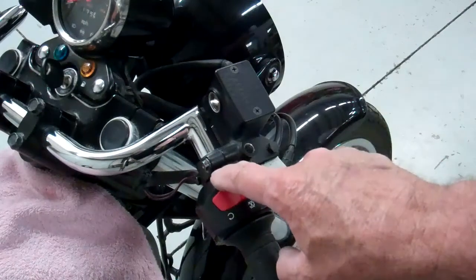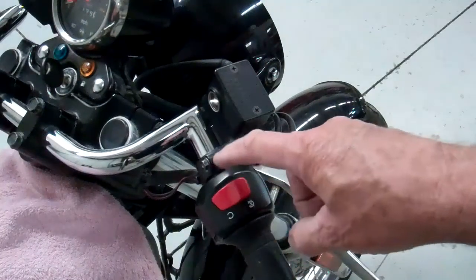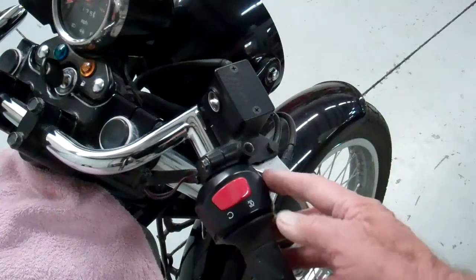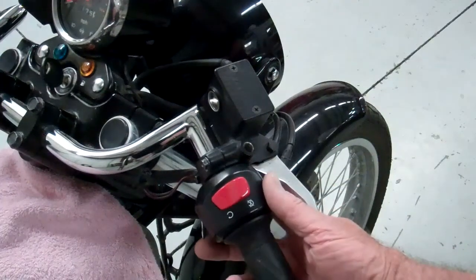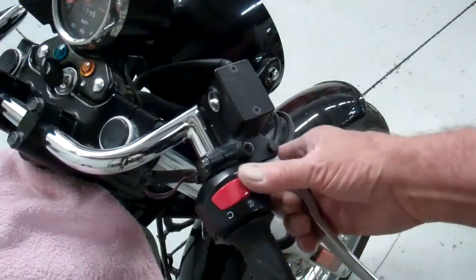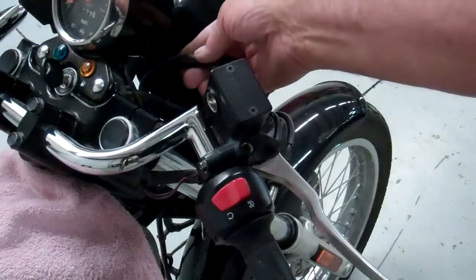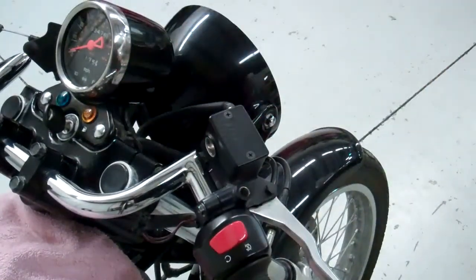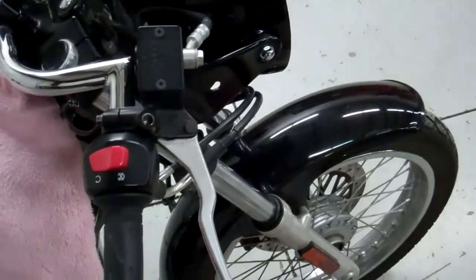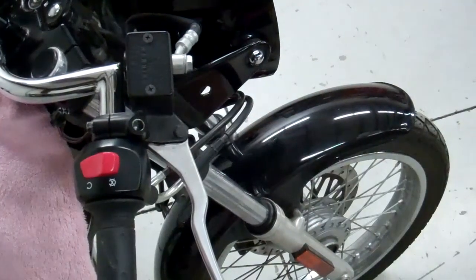I've tightened the clamshell. Make sure you get the little peg that goes into the hole in the handlebar that we drilled for you — that way it won't rotate and it'll clamp nice and tight. Don't get too carried away with the screws on the bottom since they go into plastic. Same with the screws on the brake — these go into aluminum, so just snug them up. Leave your brake lever just a little bit loose right now because we're going to adjust the angle later. The brake hose goes right down behind the headlight, and the throttle cables loop right under the bracket. Let's go do the other side.